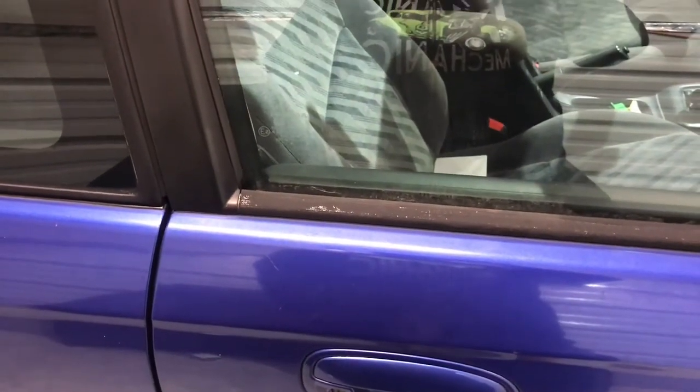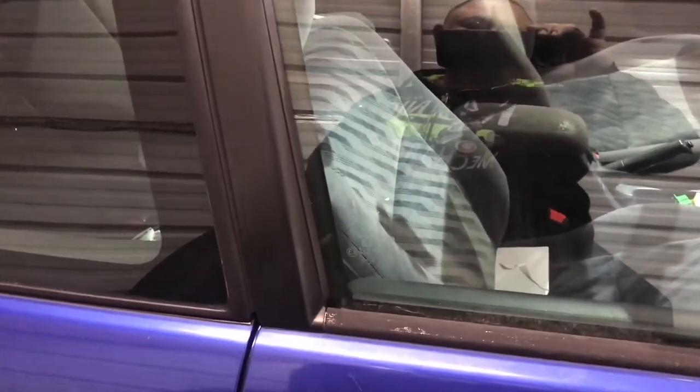I cleaned the back window just a little bit - the car's still relatively dirty, haven't even washed it yet since I've owned it. There's the driver's side. You see how bad this other trim piece is? I can fix that too - usually have to remove it, clean it with a wire wheel to get all the oxidation off, then hit it with the SEM. I've done this years ago and they come out looking great. I did go ahead and buy new ones, but these will get replaced when I take the car into the body shop to get it resprayed.